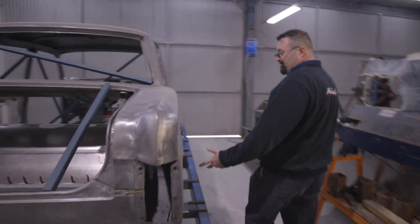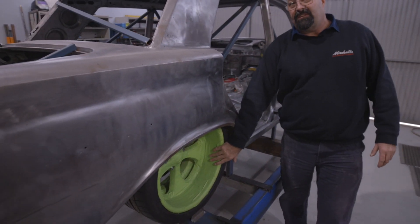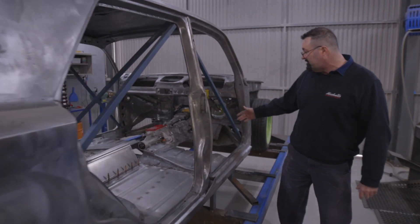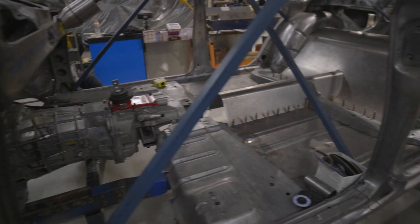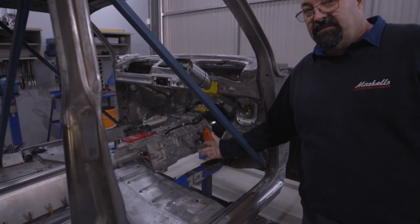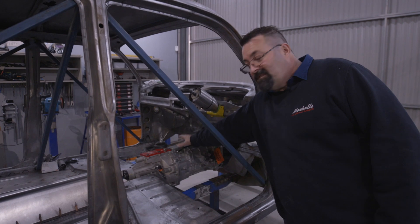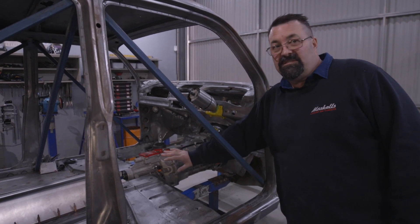With this, they didn't run bigger wheels originally. The owner wanted some nice deep dish wheels, so we've done deep dish wheels on it front and rear. As you can see in here, we've got the chassis rails connected to the subframe. This thing's running a six-speed manual, which creates a few more issues because we've got to fit everything in. These gearboxes are very high, so the trans-tunnel and firewall area just doesn't fit.